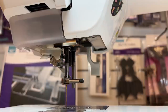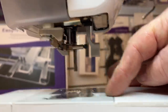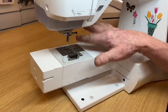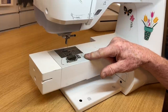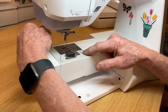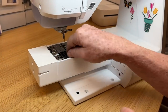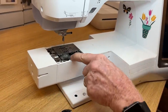On this machine we can't get to the upper support, but the lower is going to help. As a bonus, most models except Bernina have drop-in bobbins. The drop-in bobbins are on top, and Baby Lock and Brother have a really slick method. Some new Janome needle plates are held on by a magnet or pressure — you just push a flip. But there's a two-part needle plate on Brothers and Baby Locks. This plastic gray part clicks right off — put your fingernail on the back part and pull toward you and this L-shaped part of the needle plate comes off. Then you can take out what I call the bobbin basket or bobbin holder, and while that's out you can clean in there.